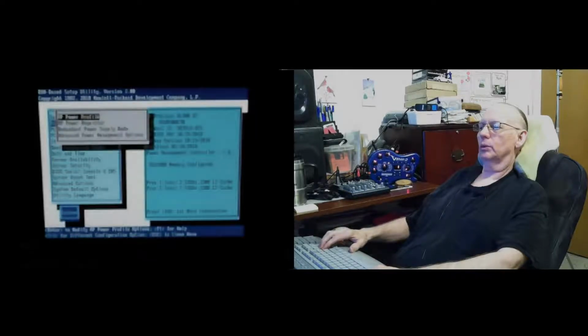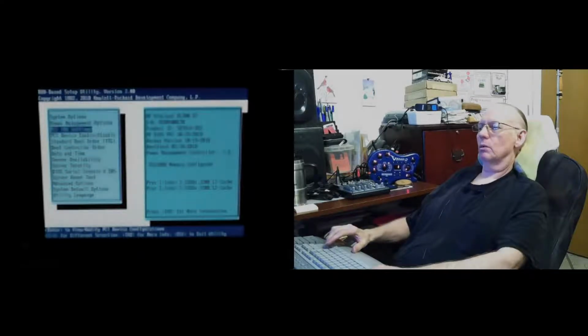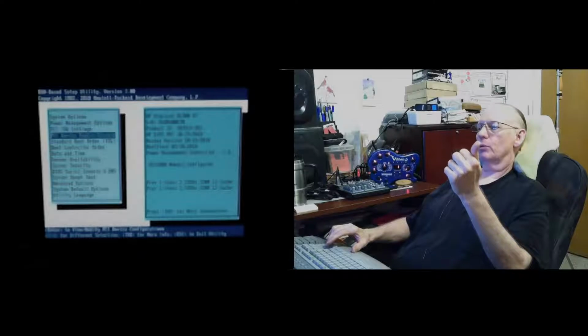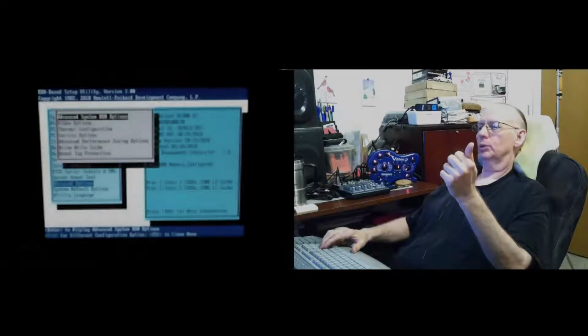Okay. Serial port, embedded NICs, USB, processor, numlock. I don't want to mess with that. Power management, I have it on custom because I selected OS control mode on the HP power regulator. I thought maybe that would be a way I could get it to work, and it still may be. It's ramped up all the way, just like it has been, but it's also set to see the video card first and the VGA onboard second.